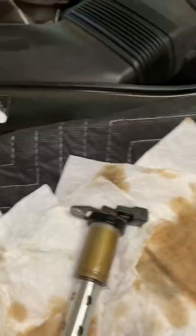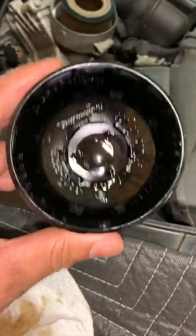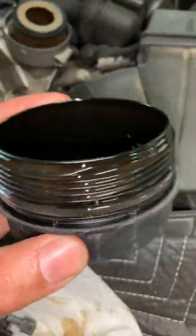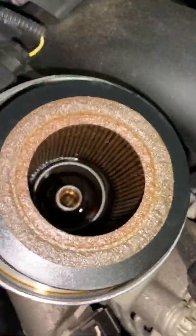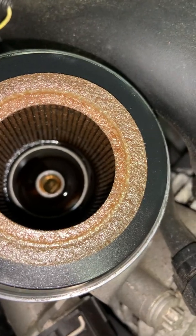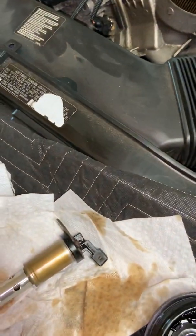The other thing I did — which I should have done before anything else — I took off the oil filter cap, and it's missing the center piece. There's a little shaft that goes up, about this tall, and at the very end there's an o-ring. The entire piece is missing. As you can see, it clips right in the center there. That little tiny hole you see down there is where the tip with the o-ring goes, and that's what divides the oil going to the VANOS.